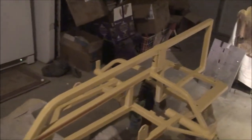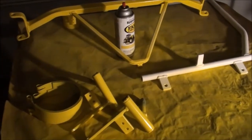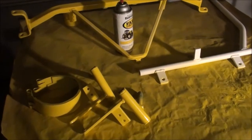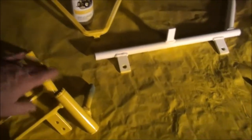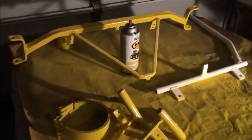The frame is in primer and curing — we can't do much with it until everything's perfectly cured, and that's part of the problem with this project. Paint takes so long to dry before you can sand on it. But it's tough enamel paint, which is what I wanted on the bike — if you get a scratch you can pretty much polish it out. With fast-drying paints, if you get a scratch and try to rub it out, forget it — you're going to have to touch it up. Thick enamel paint is tougher and polishes out much better.